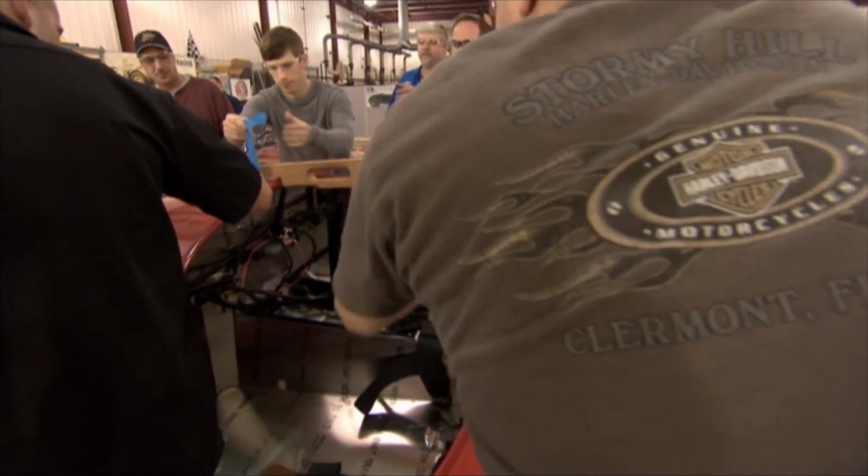Well, you were saying normally in the process, guys take this thing on and off a couple of times just to make sure things fit. Typically, it's going to be at least twice. You're going to build the car once, and then what's going to happen? You're going to fit everything up. You're going to fit the lights. You make sure the side pipes fit. Make sure the windshield posts fit. Make sure the roll bar fits. Then you're going to take it apart, okay? And then you're going to blow it apart for paint. Typically, that's going to happen at least once, if not twice. It's just a matter of being ready so that you don't have to cut the paint after the body goes together for that last time.